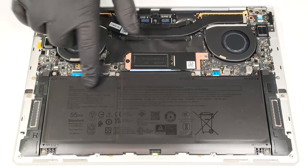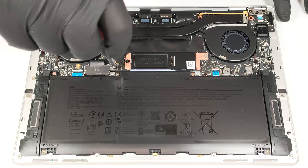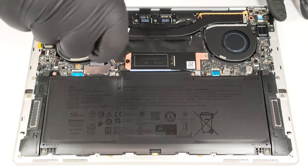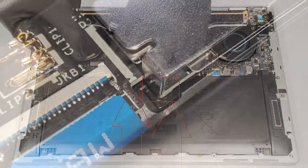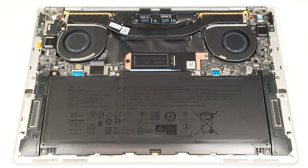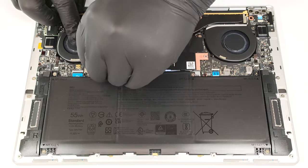The machine has a 55-watt-hour battery. A metal bracket is positioned on top of the connector. Don't forget to grab your gloves before tackling any electrical work. Undo the single screw that secures the cap in place and slide the tiny shield to the left. Keep in mind that its bottom foot is positioned underneath the motherboard. Now you have access to the connector.